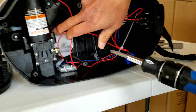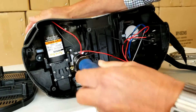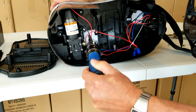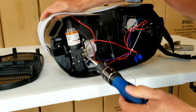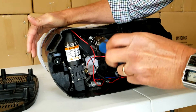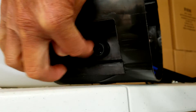There are only three mount screws going forward. They're standard Phillips and they hold some rubber feet onto the base, which makes it shock-proof and protects the motor from damage. The order you do this probably isn't critical — you can take these screws out now or later. There's no fourth foot; you only need three to keep it stable. The pump is also held in place by the neck, which comes through the hole — the threads from the motor are the threads you attach the hose to.